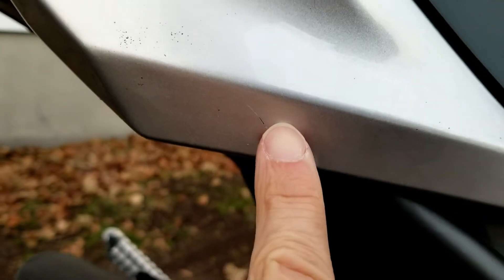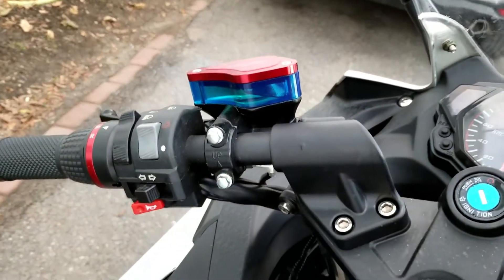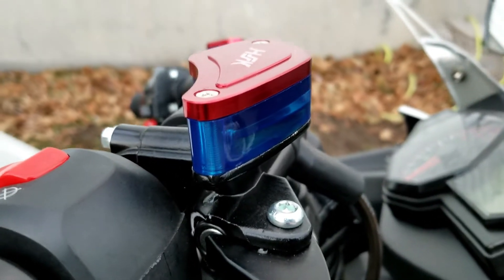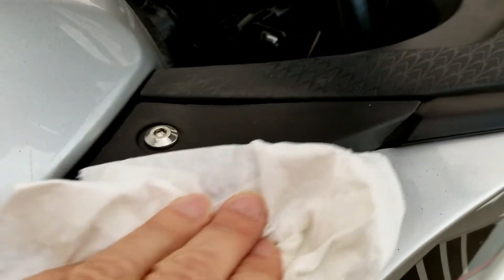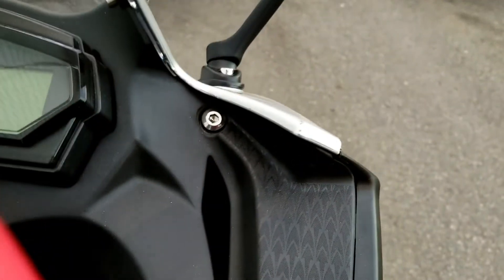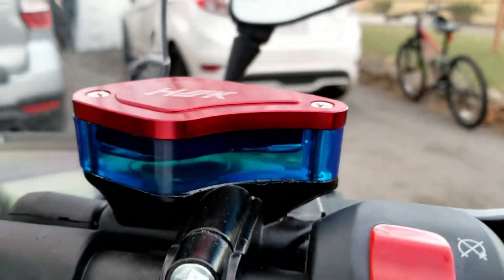On mine there's also a smaller scratch on the plastic. And on mine, the rear brake reservoir on the left is fine, but the front brake reservoir on the right is leaking. You can see it leaked while the bike was sitting in the garage the last couple of weeks waiting for warmer weather, and there's brake fluid visible underneath as well. I'll need to look into whether it's a reservoir quality issue or whether it simply wasn't tightened enough.